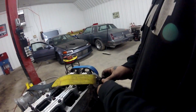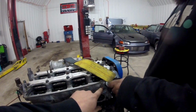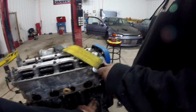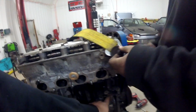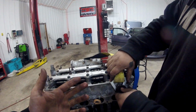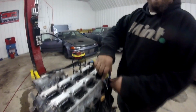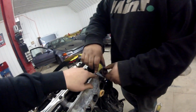So Christian is just putting a bolt through the cylinder head right now. We usually either use the bolt here on the cylinder head for the power steering, or we use the AC brackets down here that are in the block. They're just the 14mm Honda bolts, which I believe are a M10 or M12 size bolt. So he's just getting that on there. Good idea on the washer.